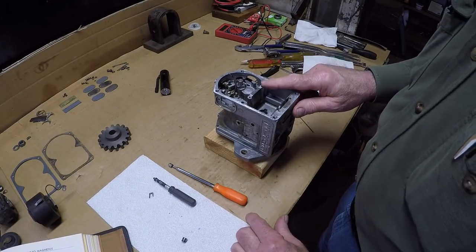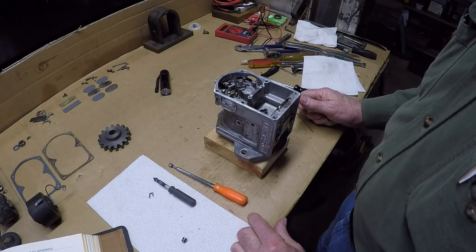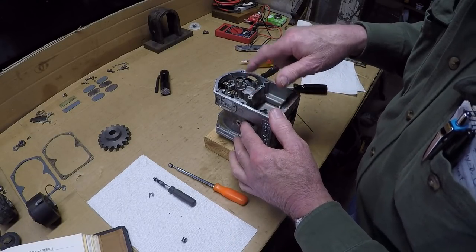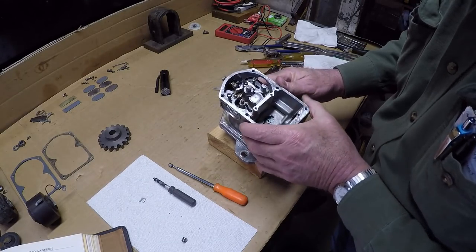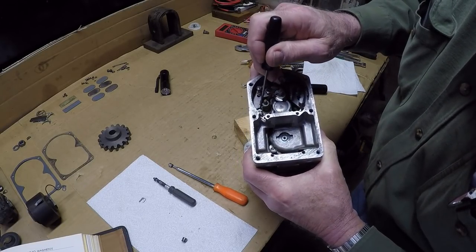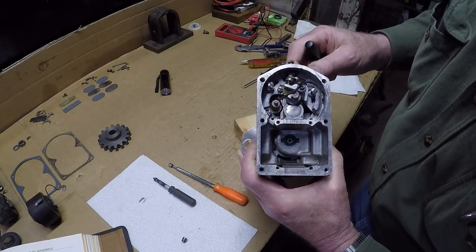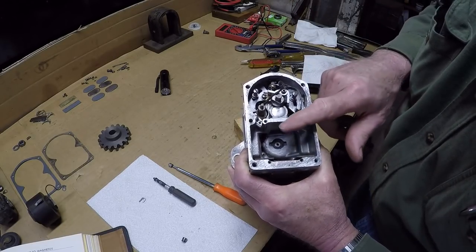Another thing to mention when setting edge gap: you can also use an ohmmeter. As you can see I've got a digital multimeter in the background — it does the same as that test light, so instead of making a special test light you can just use an ohmmeter. Next, there are stops that go on this breaker point — a long one and a short one. The long one is installed already; you can see where it's slotted and bumps up to the end of the breaker plate. If you ever take the breaker plate out, just leave those stops where they are and that should put you right back on your marks.